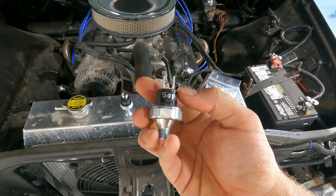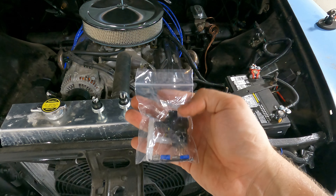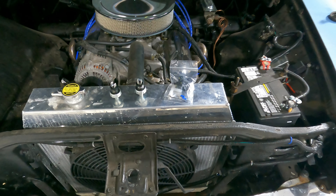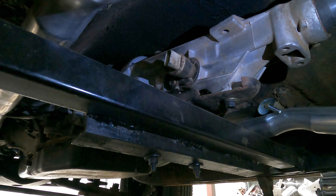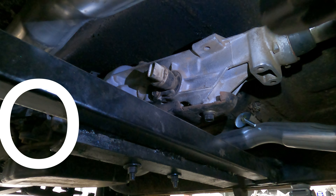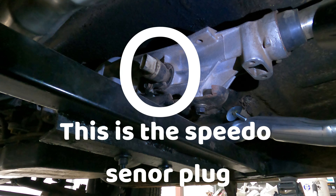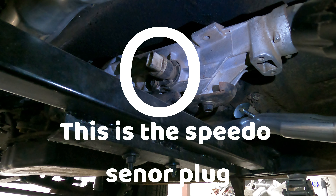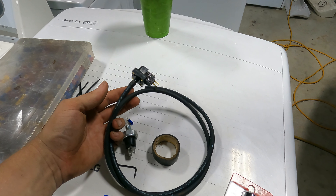And if you want to pass a Chevy on the highway, you have this kick-down solenoid. It's vacuum-controlled, and the way it works is it goes in line with these switches, and when you floor it, it knocks the overdrive off and you go back into just third gear like you're driving a 727. Let's get started. I need to get access to the transmission, so I'm going to go ahead and jack the car up. Up underneath the car, right about there, we're going to have a little plug — that's our three-wire plug for our overdrive and lock-up.